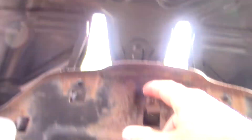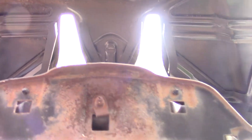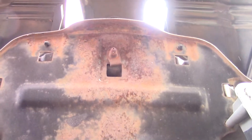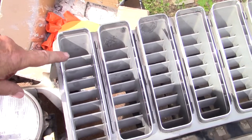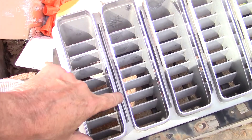There's just one more bolt to take out, and I've got to unplug the headlights, and this whole thing should come off. My car's a '74, so I don't know if you have to do this on the '73s or not, but on the '74s — and I may have mentioned this before — you have to grind these ribs out.